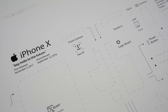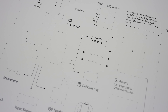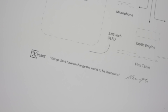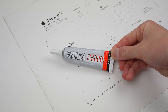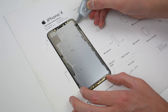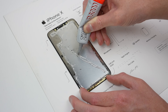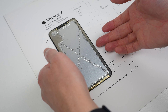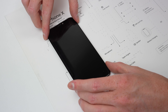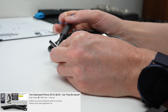Say hello to the future of this iPhone X — a work of art. This template is really well designed and it clearly took a lot of effort, though it's not without some design issues which I'll get to. To stick everything down I'll be using B6000 adhesive, which they sent along with the frame. The first thing I'll stick down is the OLED display panel, running an adhesive border around the perimeter and a little in the middle. Once aligned, it can be pressed into place, and beside it should go the mute switch and display bracket.